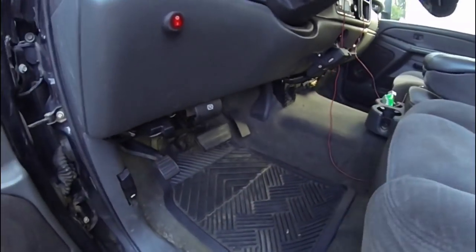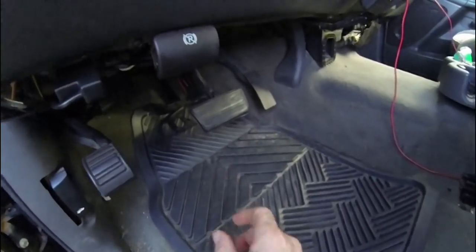Let me show you where it's at. You've got the brake pedal — follow it all the way up until you see the wiring harness right here, connected to the brake switch itself. First, take off that 10-millimeter nut or bolt. Once that's off, pull off the retaining clip with the flathead screwdriver, disconnect the switch from the brake pedal bar — it'll come disconnected and the brake switch will fall out. Then disconnect the wiring harness and install the new one.